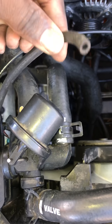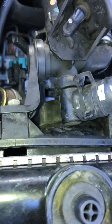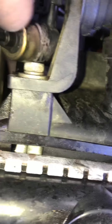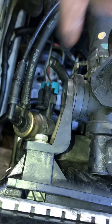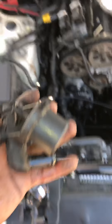Look how brittle it is — you can just look at it, it's literally degrading. So what it really comes down to is: you've got these holes right here for the valve, this hose right here, this hose right here, this 10-millimeter bolt, and these two wires and this connection. Get all those off and you're good.